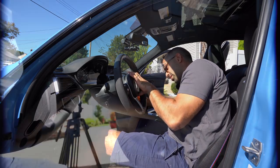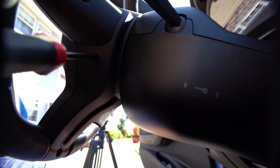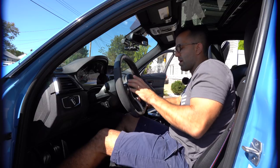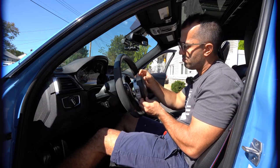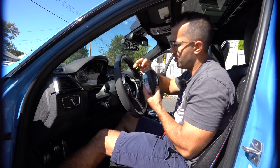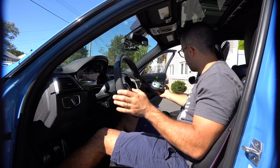You see how it popped out. Same thing on this side — don't confuse the holes. Push the screwdriver in, wait until you feel the spring, and pop it out — the airbag simply pops out. To remove the airbag it's again a simple clip: you pull it and the airbag is removed. Now set it in a safe place.